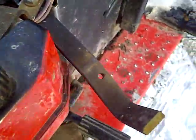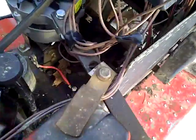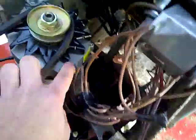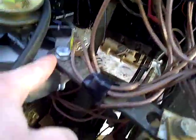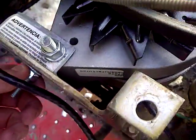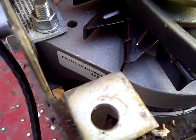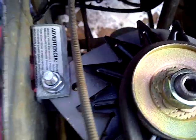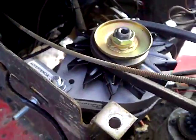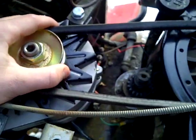The way I set this mount up was I just got a piece of steel right here and drilled a hole where the gas tank was. This was where the mount was on the alternator, so it was just an easy mount. On the other side, I got a piece of metal, bent it into a C-formation to fit around the alternator mounting holes, then went to Home Depot, got some bolts, and bolted it on. It swivels so you can tighten it depending on the belt length.